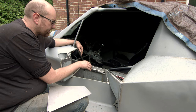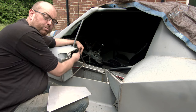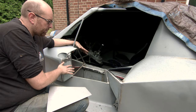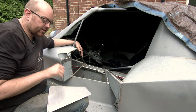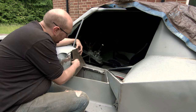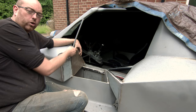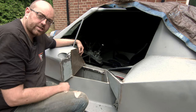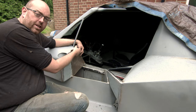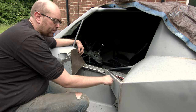Moving the spar is just so that the access way through this panel is going to be a little bit easier. I've also added in this brace that goes from the outside of the wing all the way down onto the inside of the cab. That now frames up the rest of this section really nicely and I can get this panel welded on - it goes on like that. It's a little bit tall at the top, but it's easier to weld it on and then trim it to size once these pieces have been welded on.